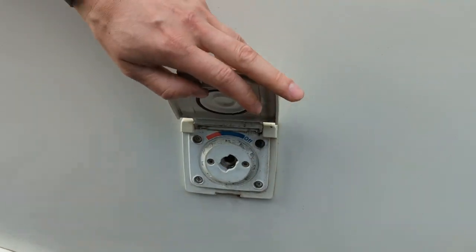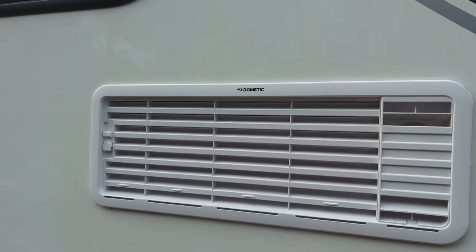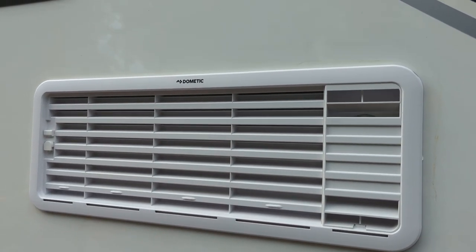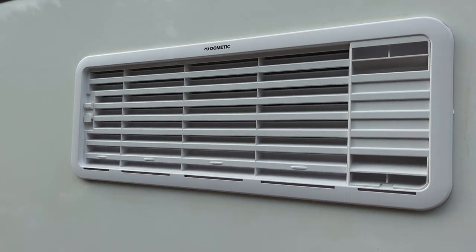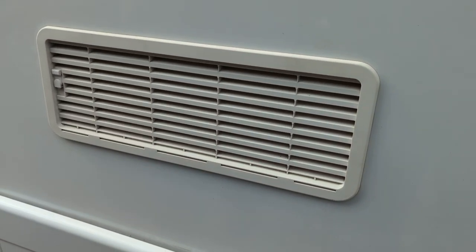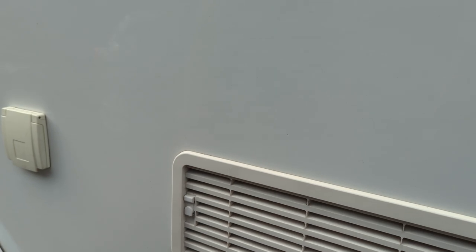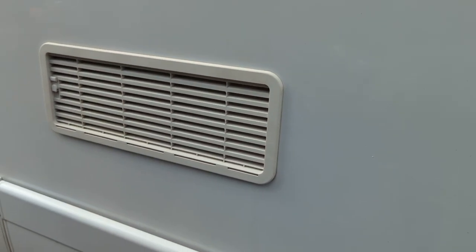There's the external shower point there. You have vents for your fridge here — there are winter covers you can get. If it goes below 10 degrees you can clip them on and it'll help your fridge run better in cold weather. If it was really hot, say about 30 degrees, you can remove these vents with a small flat screwdriver — poke these up and wiggle them off. That'll give your fridge better circulation at the back and it will run better in the hot weather.